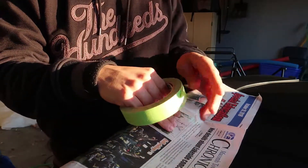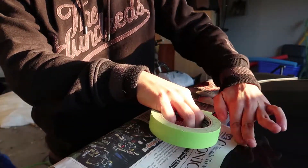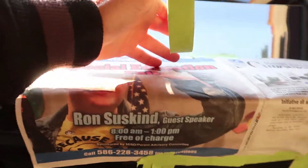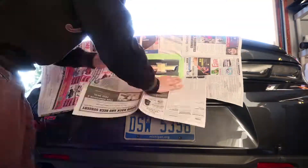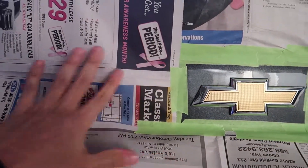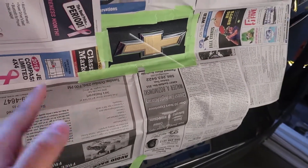I'm holding it over the trunk because people don't really realize the overspray gets on the top of the car as well. That's looking good right there — it's just covering up this whole top half of the car. We're going to do the same thing for the bottom and the sides. So we are done masking off the badge. We got the initial square and then newspaper going out from the square to prevent any overspray from getting on the paint. We also have it all the way on the top just to be safe because it is hard to get off.